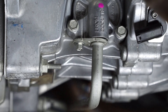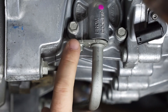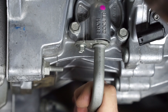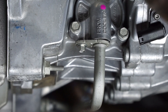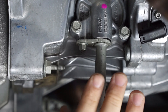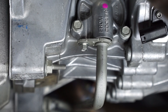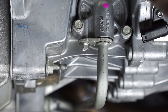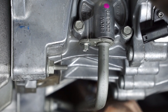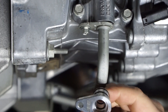So really it's not an issue with the machining on the transmission end — it's actually the production, how these lines are produced and physically sealed into the case. So what we basically did is come up with a way to fix the deflection issue and seal it all at the same time. What I'm going to do here is show you what the seal looks like that we came up with and kind of how it works.